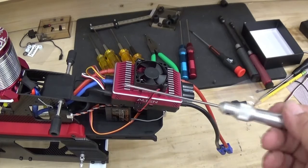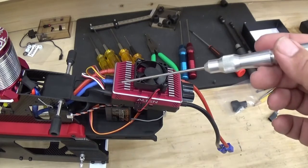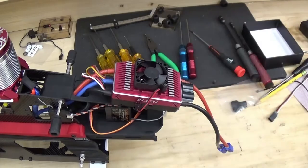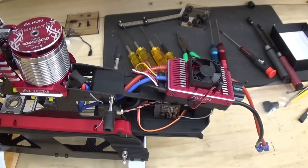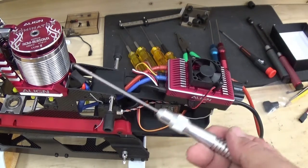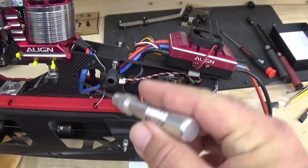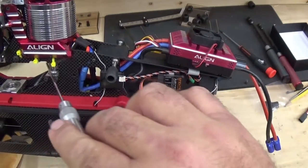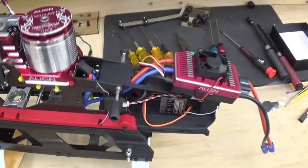We've got the speed control mounted on top of the overall battery tray assembly with the power leads going forward. The motor leads are going aft, down through the upper tray here into the frame. The easiest way to do this is to actually remove the motor, pull it up, route the wiring through the holes and back up. Plug the three leads in based on their color combination and the excess length will wind up down inside the frame. It misses the gear completely and is well outside of the battery tray — it just seems like the best all-around wiring.